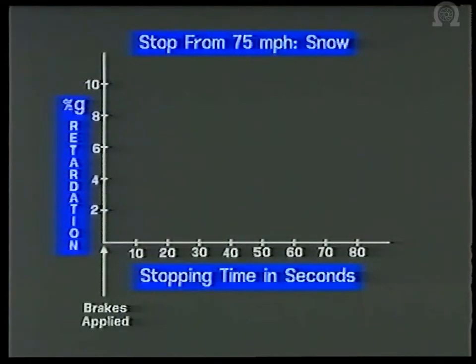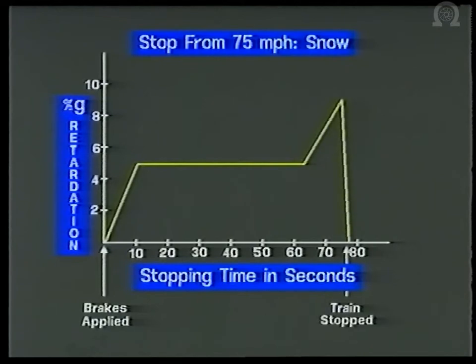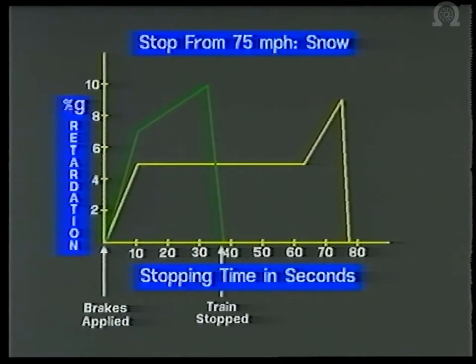Let's have a look at some test data to illustrate the point. In the first example, the driver made an initial application as a running brake test. In the following full-service braking, the stopping time and distance was considerably extended — the brakes were still aquaplaning. In this condition, the brake power can be severely impaired. In the second example, the driver made a full-service brake application as his running brake test. In the following service stop, the braking time and distance was greatly reduced. The brake power was greater. There was no aquaplaning.